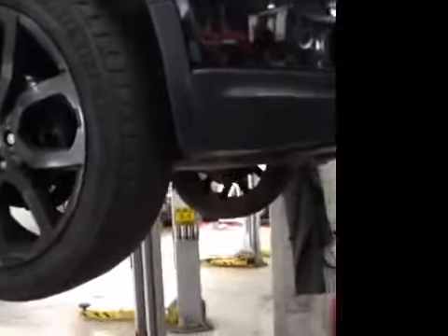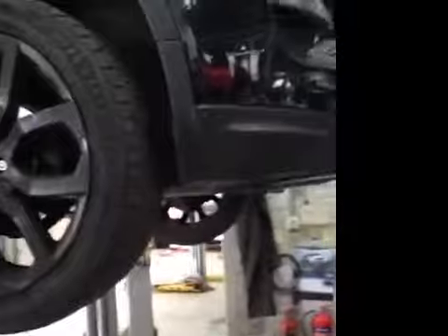Starting off with your offside front tyre. You've got 3.5mm tread on this tyre — I'll mark this tyre up in amber on your vehicle health check. Front discs are in good condition. Front pads are now on about 3mm, so I'd advise for them to be changed. They're in red on your vehicle health check.